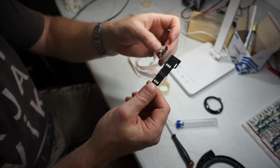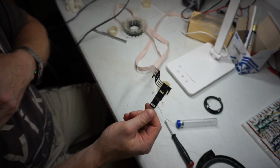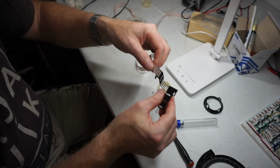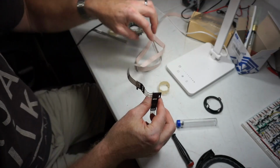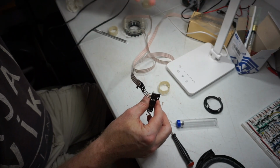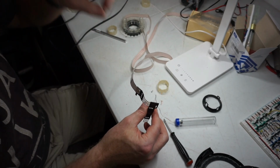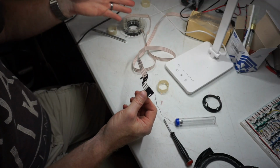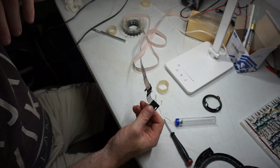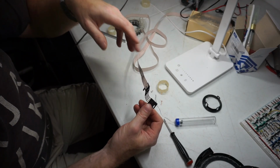It's less than 0.1 ohm across all 4 of them. So it's just soldered, but I feel like there should never really be any pressure on that. There's plenty enough ribbon cable to wrap around here like 3 times. I think it's like 2.5 rotations in each direction. The hard part now is going to be getting the thing back together because I don't know exactly how these were wrapped. So I have to figure out how to get it wrapped where I can rotate it at least 3 times in each direction.